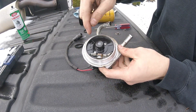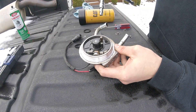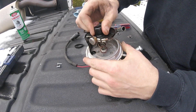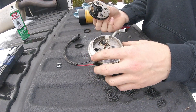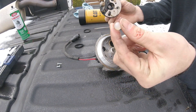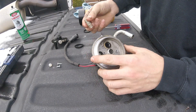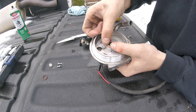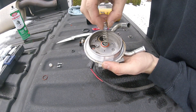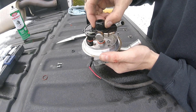We're gonna flip this piece over and take out these two bolts, which are also T20. This black piece comes off, and as you can see the orange o-ring just fell off — we're gonna be replacing that. Take this ball off, then take the spring out. Go ahead and install a new o-ring right here. Once you have that o-ring installed, put the spring back in place, then the ball goes on top of the spring, and the black piece goes over the spring.